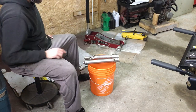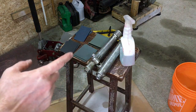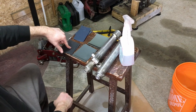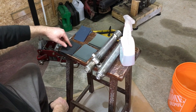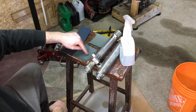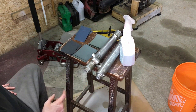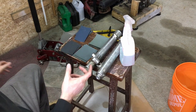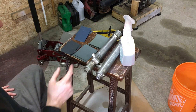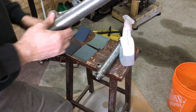I've got my stuff set up for sanding. We're going to start with 320, go up to 600, then to 1000, and then the last step from 1000 we'll go up to 2000. By then we should see little or no scratches left in the forks. At that point I'll get my polishing hardware attached to my drill and I've got some Mother's polish.